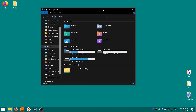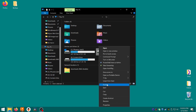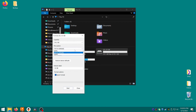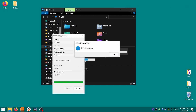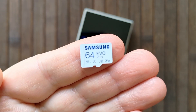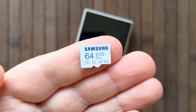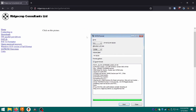Now we'll need to format your new card to the FAT32 file system. If you have a 32GB card or less, you're in luck because it's really easy. Just insert it into your PC, right-click it, and click Format. Open the File System drop-down and click FAT32, then click Format. Note this will delete anything you may have on the SD card already. If your SD card is bigger than 32GB, you won't be able to use the Windows Format tool to change it to FAT32, but it's still pretty easy using a software called FAT32 Format. I've left a link to it in the description box below.